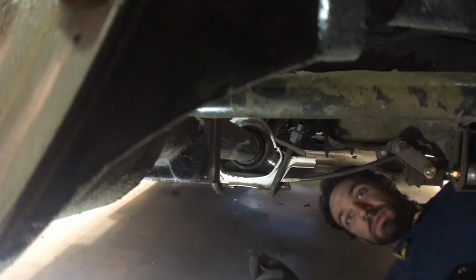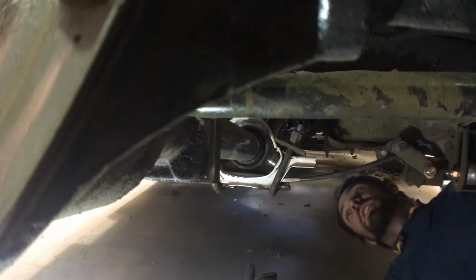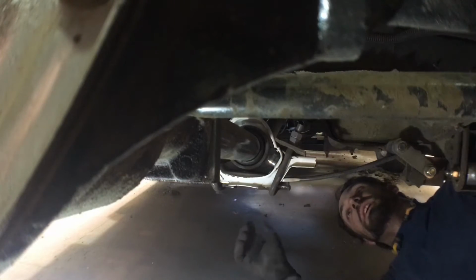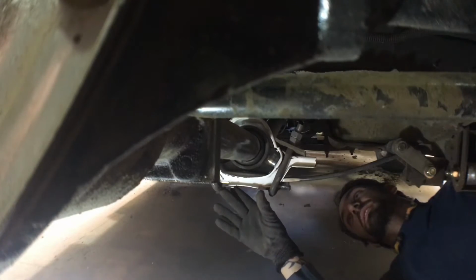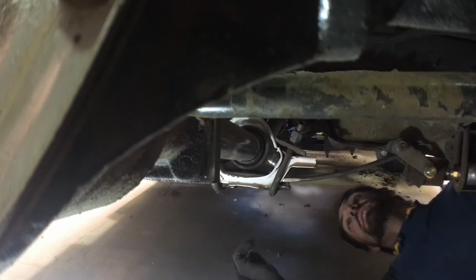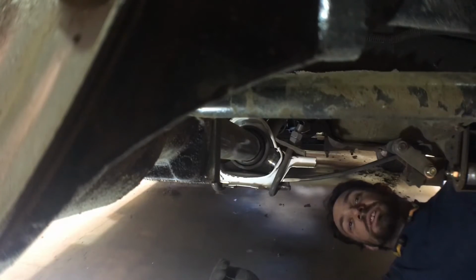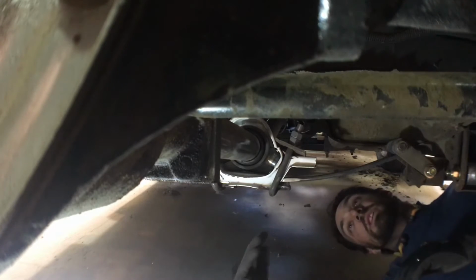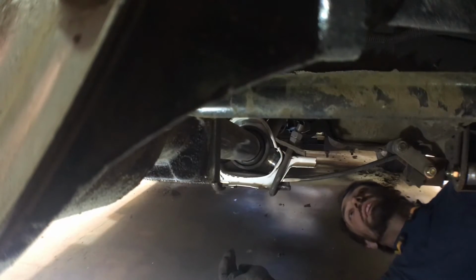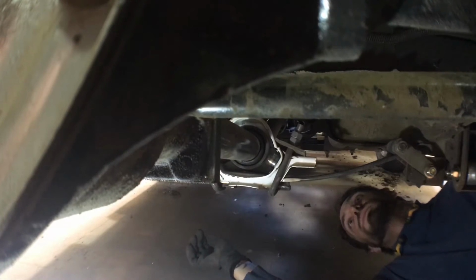So even before the very first race, just loading the car onto the trailer to take it to Pop's Chops, I mangled up this leaf spring mount. What happened is I had the U-bolts facing down. It was easy to put in, easy to take out, but they hung down really low and they caught on the trailer and bungled them all up. So when we got it back to Scotty's, we took it all apart and made the U-bolts go up, keeping the ground clearance as much as possible. Seems to be holding up pretty good now. I double nutted it so they jam up and don't come loose. Seems to work pretty good.